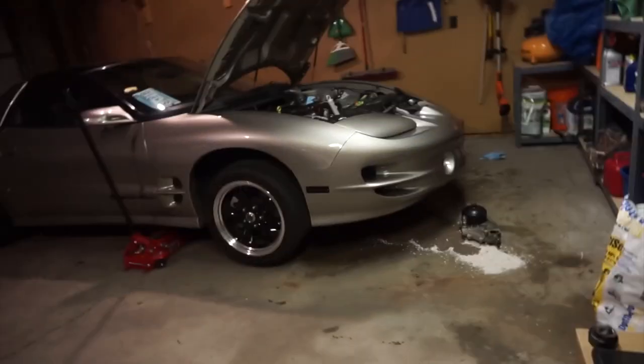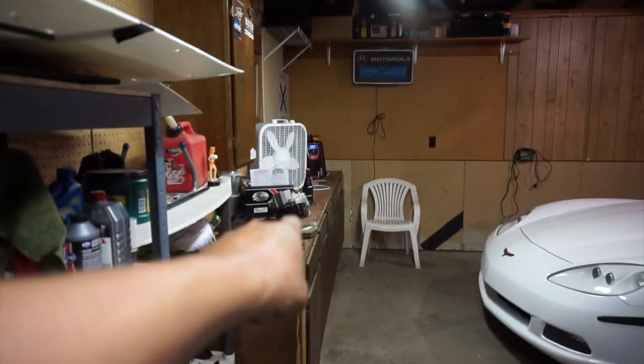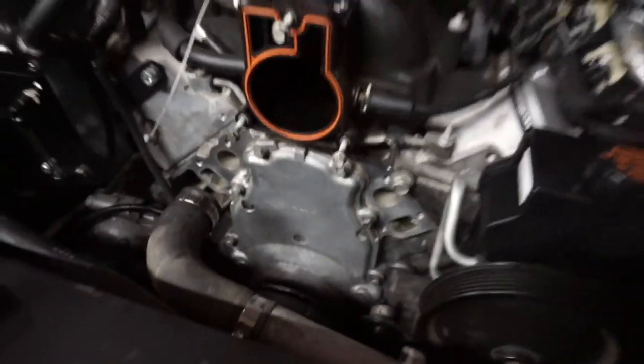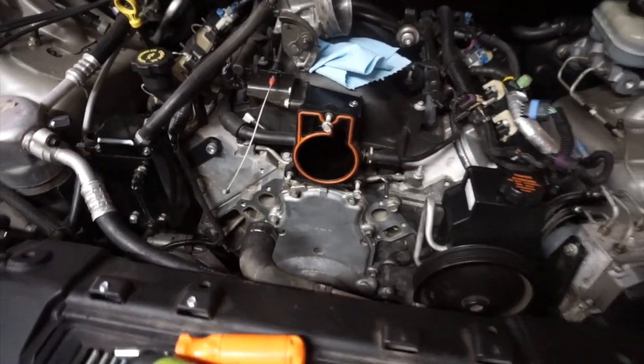So I kind of reached a stopping point tonight. I got the old water pump out down there. I got the old thermostat out and the thermostat and housing installed on the new water pump. I got the mating surfaces of the water pump all cleaned up, timing cover all cleaned up, and other assorted things down there just kind of wiped off, and some of the schmaggle cleaned off of them.